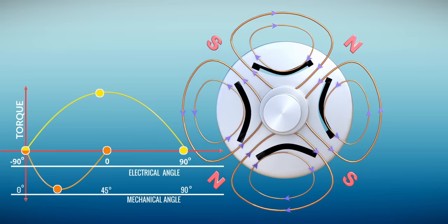Model 3 uses a 6-pole design, which is no different than a 4-pole design apart from getting higher torque. Tesla Motors is not the first company to release such an innovative motor — the Toyota Prius, a hybrid electric car, uses similar IPM-SynRM motor technology, with two IPM-SynRM machines: one for motoring the car and another for generating electricity. An interesting difference between the Model 3 and Prius motor designs is in the magnets: Prius motors use solid magnets, whereas each magnet in Model 3 motors is segmented into four parts. This segmentation reduces eddy currents in the magnets, preventing overheating and demagnetization while running the motor cooler.